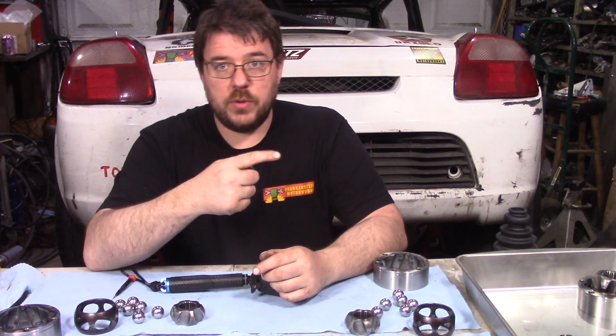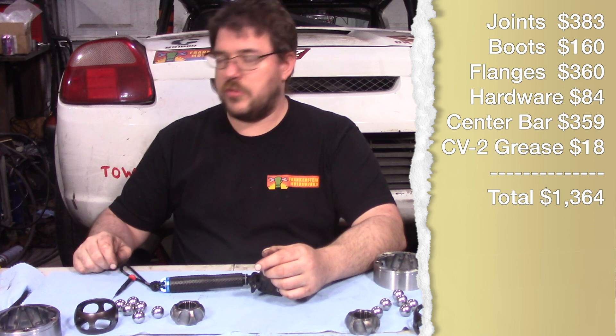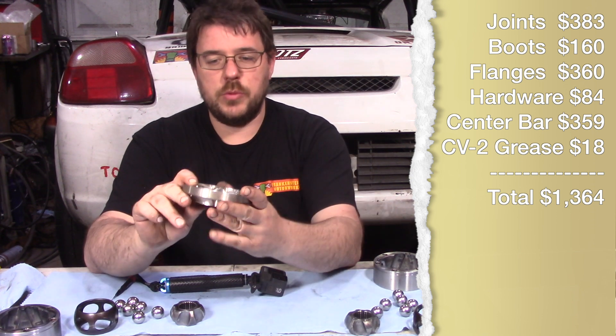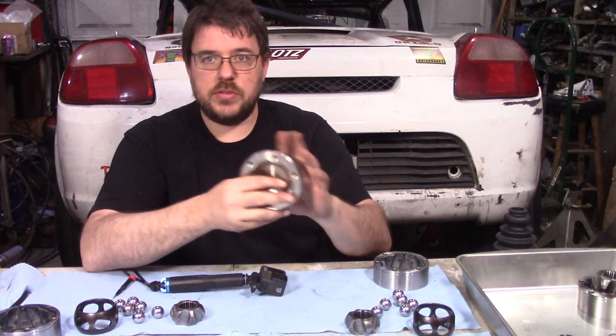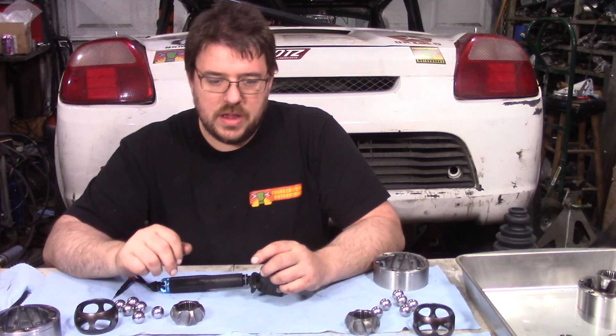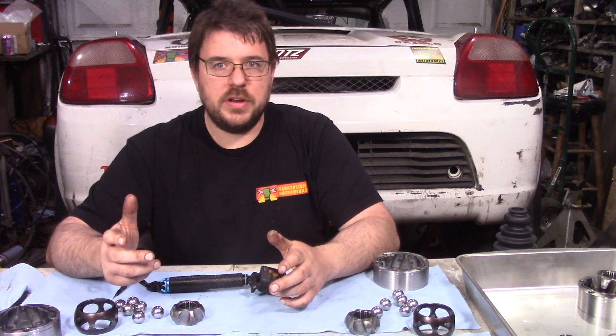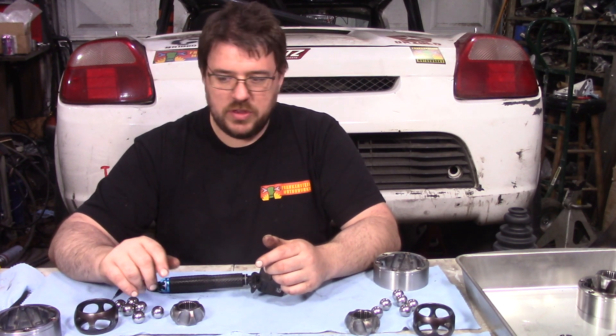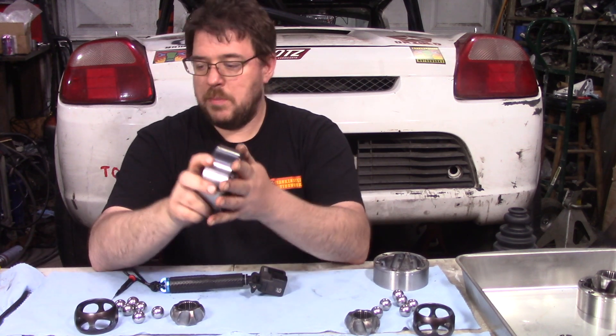Now, what did this cost? Well, there's a breakdown. It's a little under $1,400, and that's not quite true because I had to get a pile of these manufactured to bring the cost down, and that pricing only accounts for four of these. But if you look at custom axles, normally $1,400 — I won't call it cheap, but it's certainly cheaper than some of the options out there. And what I really like about these, with the bolt-on joints on both sides, it means I can actually service the darn things. An outer CV normally is just such a pain to disassemble. This is better.